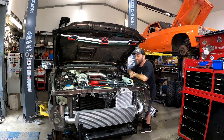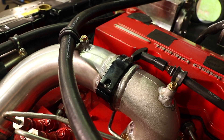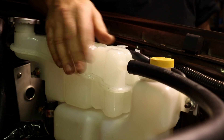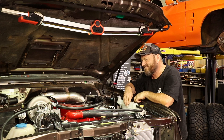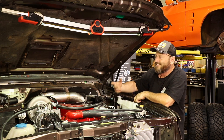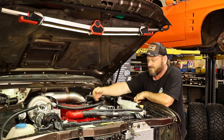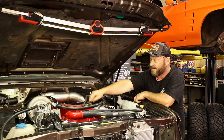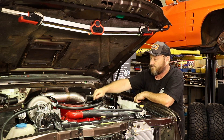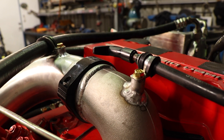I got to making a few brackets for the hoses — aircon hose, the coolant overflow or heater hose. And also the dipstick is a big flexible unit that bolts on. I don't know where it actually bolts on because it used to have a VP pump on it, but I just made a mount to come off the top of the new air horn that we've put on the inlet manifold there. So that's all good to go.